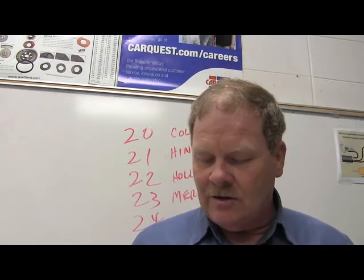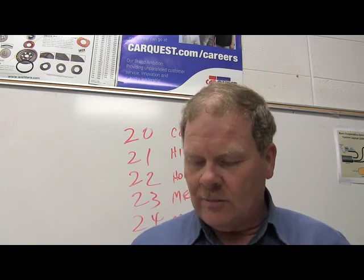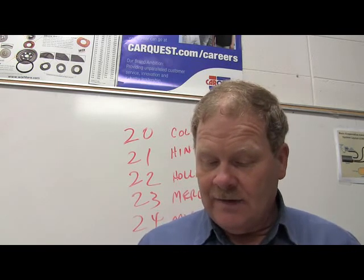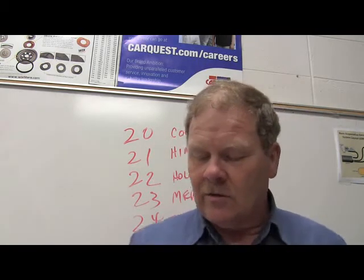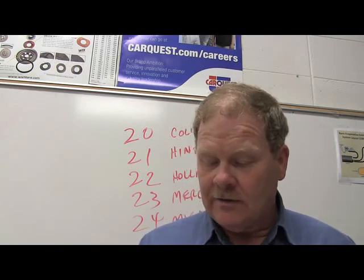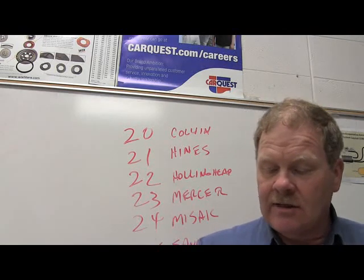Technician A says use a face shield when using any type of pressure or chemical procedure. Yeah. Technician B uses protective gloves when working with solvents. Who's correct about that? That's C. Technician A says use three-prong electrical cords when possible. Technician B uses double insulated electrical tools. Who's right about that? Both of those guys are right. Which substances can be used as abrasives for cleaning?